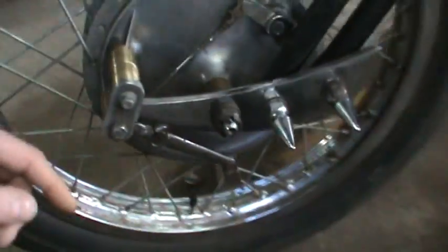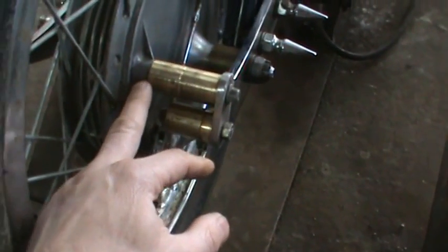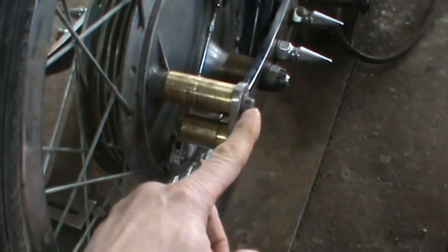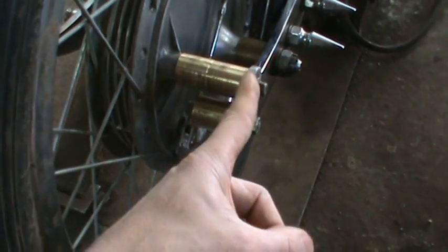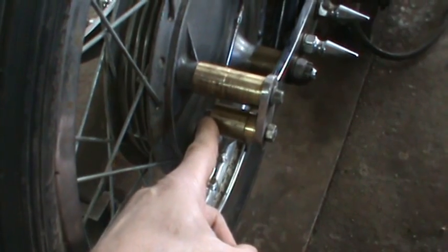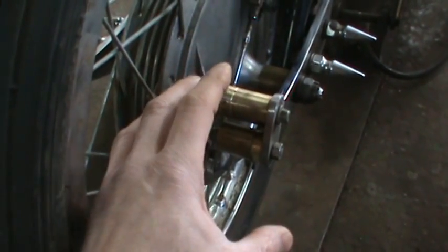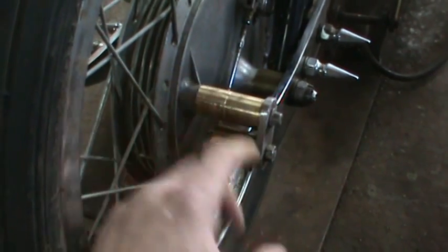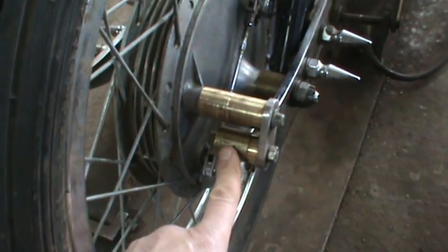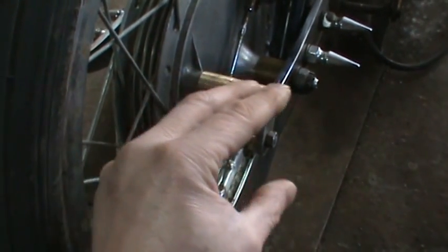So, as you can see, that's where the brake lever cable goes, straight up, and the boss is under here. Right there. And what I decided to do was took some more brass and turned them down and hollowed out the inside, so running just a long bolt right through it, and then came with a keeper coming down and then another one returning somewhat. I'm going to clean these up when I take them apart, but I want to get the mechanical structure of it correct first. And I also took this one and I put the 4-jaw chuck in the lathe. That allows you to move a piece off center when you're trying to drill it.